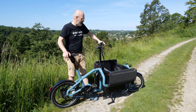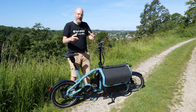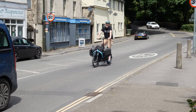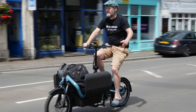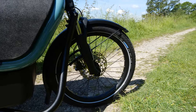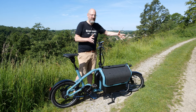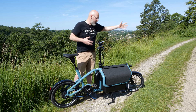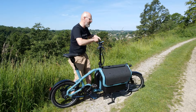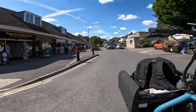This is a compact cargo bike — the overall length is 209 centimetres. Compare that to the Transporter 65, which is a relatively small cargo bike, and that's roughly 30 centimetres longer. To achieve this they've used 20-inch wheels to bring the bike's height down, and the load area is only 45 centimetres long compared to 65 on the Transporter or 60-70 on the Load — but the fold-out Tardis-style front end more than compensates.